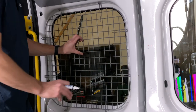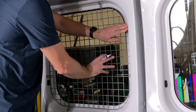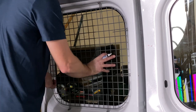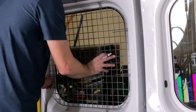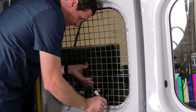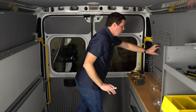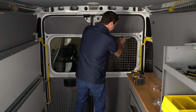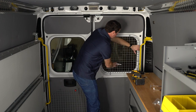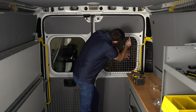I'm going to start by just marking. We're going to hold these up as best I can — I want to hold this so almost every mounting location is touching the van. I'm just using a chalk pen to mark these locations. I'm going to mark all my holes first, drill all my holes second, and then attach all my bolts third. Just in case there's any minor variation in manufacturing, I'm going to make sure I'm using the same window screen for marking as I am for the final install.